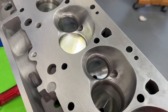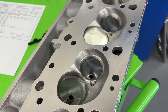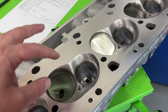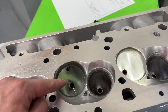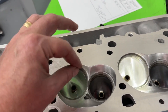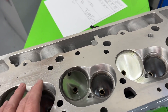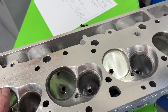The exhaust is outstanding - flat out outstanding. Peak of 334 at an exhaust valve of only 1.850, which is actually 30 thousandths smaller than what most people run for an exhaust valve. You might ask why he did that - I believe he did it so you'd have more options for cam timing. Unlike a small block Chevy or LS, these valves are actually canted, which means they move at an angle towards the center. Same with the exhaust - they move towards each other. If you make the exhaust valve smaller, you have more room before they make contact. Maybe he's thinking about people being more aggressive with cam timing in the future.